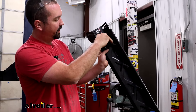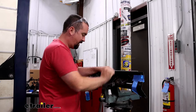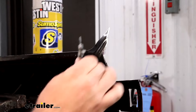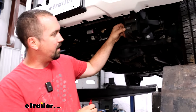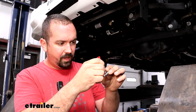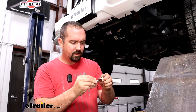This triangle shape — just follow the long edge straight down. For cutting you can really use anything, but I recommend an angle grinder; it's going to go through this pretty easily. Clamp this down, get it cut out, and obviously wear your safety glasses because we're going to be throwing some sparks. With those cut out, I've gone ahead and painted these up to cover the raw metal. We're going to be bolting these back in place, but do not use the factory hardware that we removed. Grab these bolts, and with every bolt we put on from here on out we're going to be using red Loctite — the high-strength kind. This makes sure that long-term, with rattling, the bolts are never going to back out.